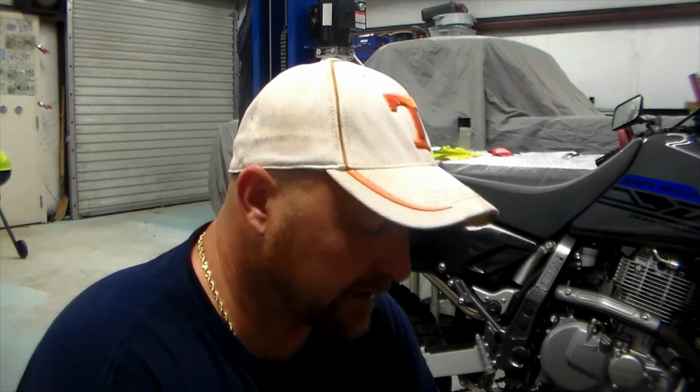So what I'm gonna do is take some thread sealer, put the screw back in the hole to keep it from chirping, and add this to my pack, and that way I've got it with me. And if the day becomes too long with this thing rattling in my head, I can add this and buy myself a little patience. So I'm gonna start the bike without the DB killer, and then put the DB killer in it just so you can hear the difference in tone. And then I'm also going to use my finger and plug the hole and then leave it open so you can hear the chirping. It's extremely annoying in just the little amount of time that I played with it. So the bolt's got to go back in.